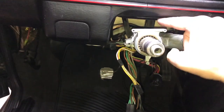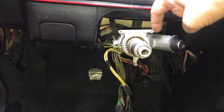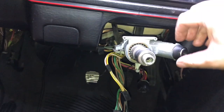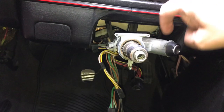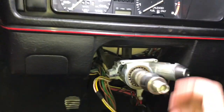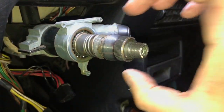I just bolted it up lightly. Now I do have to get a drill right about here — drill a hole, and that's how you release the spring that's in here. Good drill hole so you can get a pick in there, get the spring out. But right now I've got a puller and I need to get on these right here.